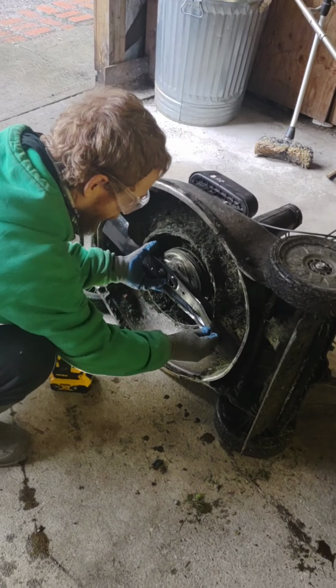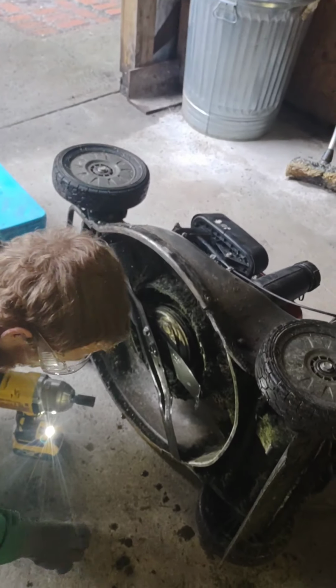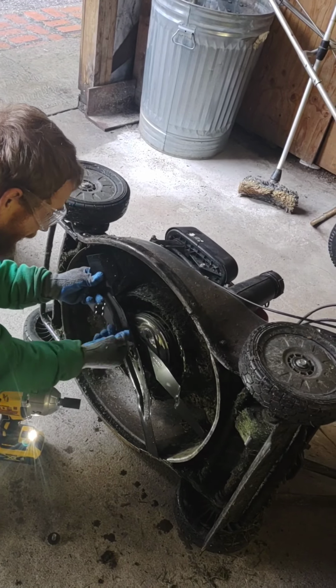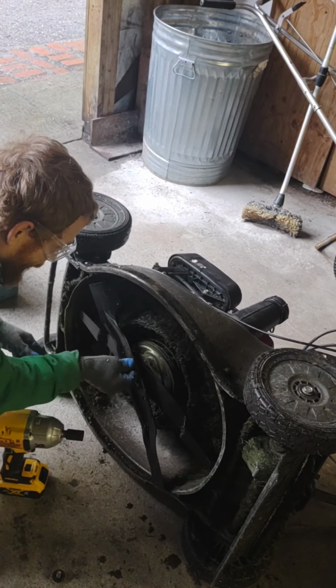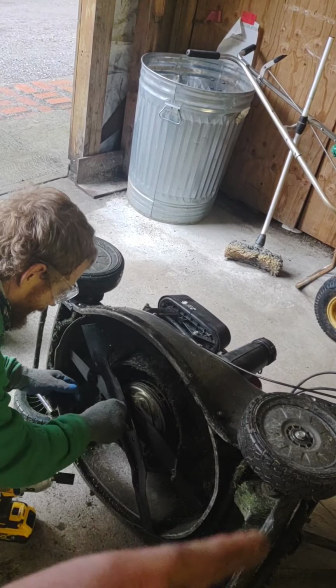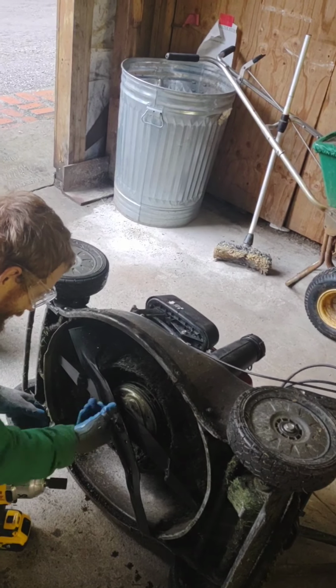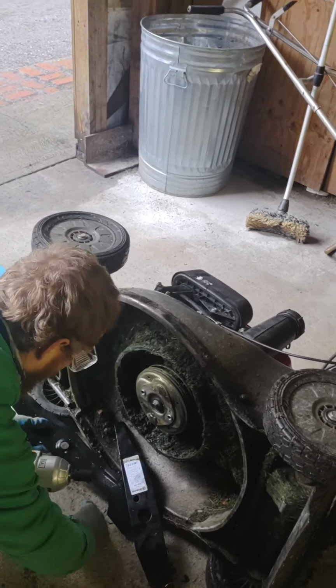But now, if you pay attention to the wingtips on these blades, it's very important to orient the wingtips upward. These blades turn in what they would refer to as a counterclockwise position from the bottom. If you look at it from the top, it's actually clockwise.